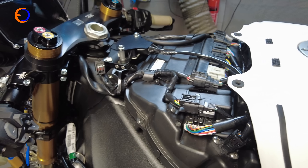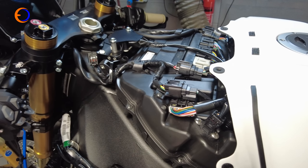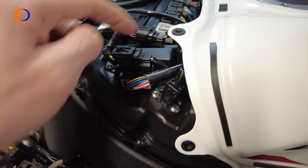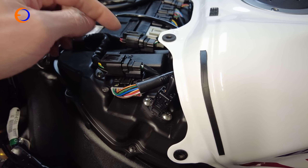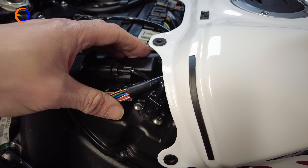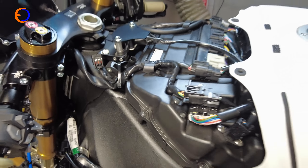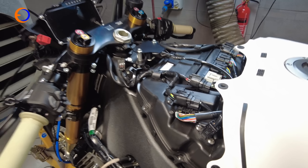Harry said 'That's not for that.' I was puzzling over what was going on, and then I realised it might be the big plug back here that I assumed was for the data logger — but it isn't. It connects into this little ECU, which I assume is for controlling the traction control and some of the non-engine side stuff. So I had a dig in the standard loom we had upstairs, found that box, plugged it in, and now everything works — which is a bonus, because otherwise it would have been slightly embarrassing turning up at Honda with a bike that didn't work properly.